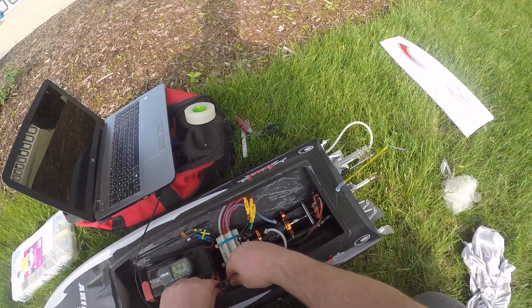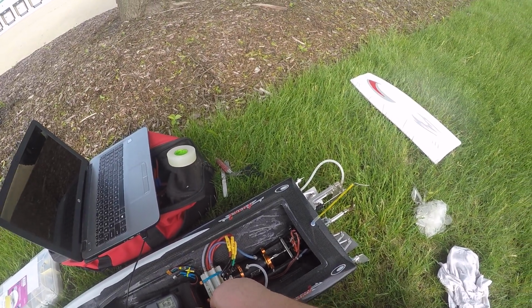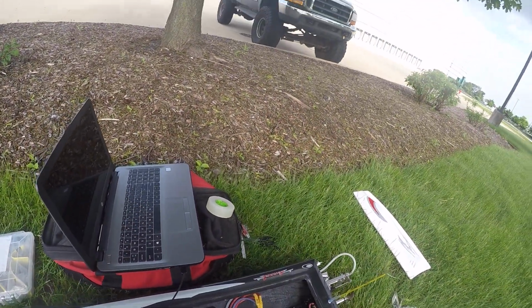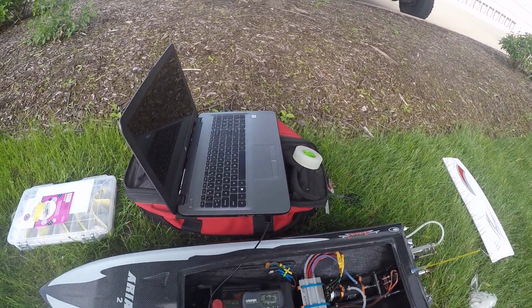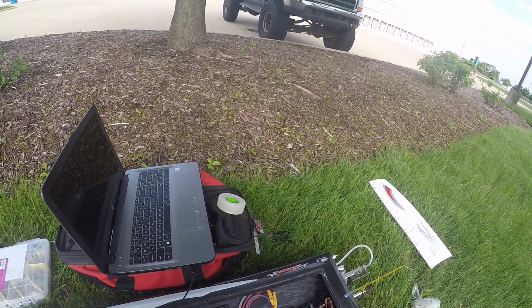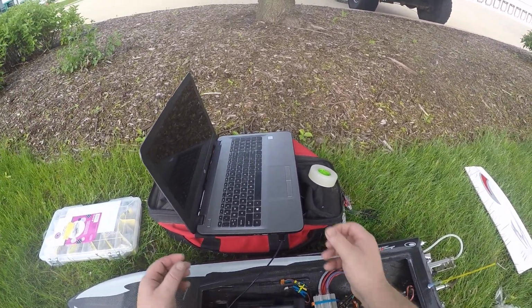I think one way that may be good to make this thing more of a driver, to where you could cycle battery after battery, would be to run 5S. Just lower the voltage, run it on 5S, and it'll probably do 50 miles an hour, and you could probably drive it non-stop.